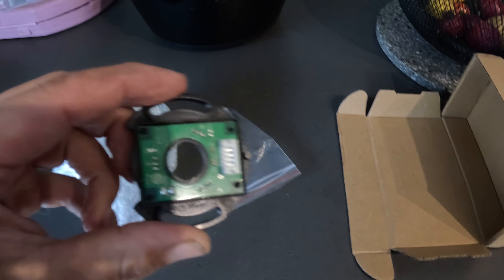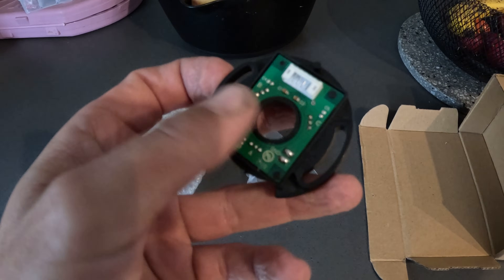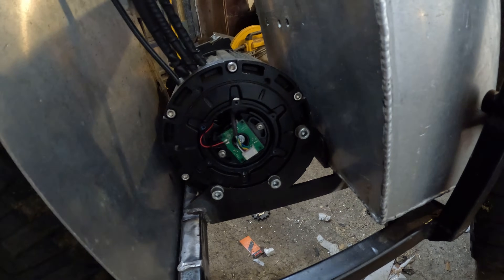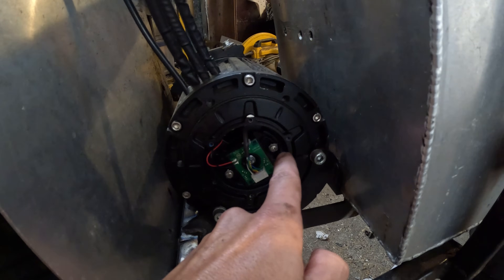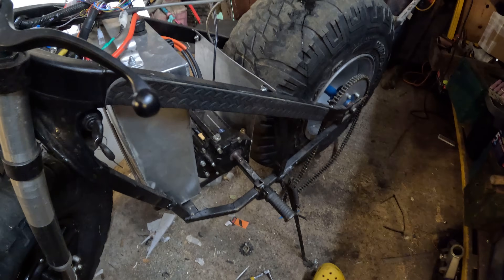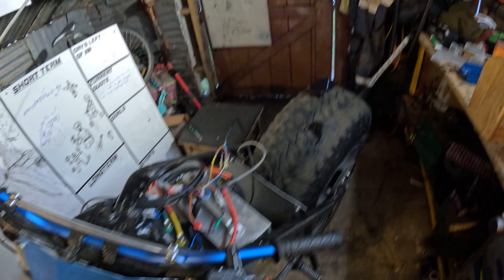Okay, it's about 10 days later, my parts came in from China — thank you, China. The hall effect sensors are in here so I can just put this in. Got the new hall effect sensors in there. You can adjust the timing with these screws but I didn't know where it was supposed to be. Ran it up and it went backwards, but I did the auto-learn sequence on the app and now we're back in action.